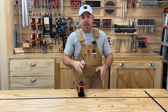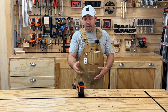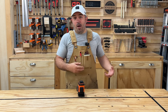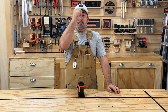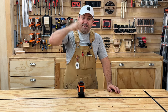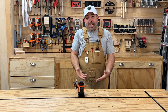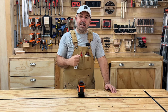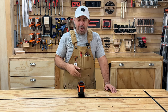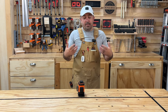This creates a thing that you need to understand for how to take care of your machine. If you were to suddenly move this, drop it, or just even moving it around during transport, that pendulum is gonna whack the inside of this unit. And over time, you might end up breaking it, or sending it out of alignment because it keeps hitting the side over here and damaging itself. So that's most likely what happened to the unit that I owned. I did not take care of it as I should.